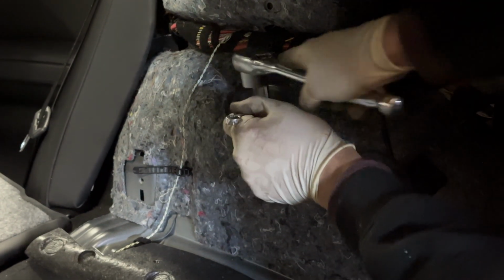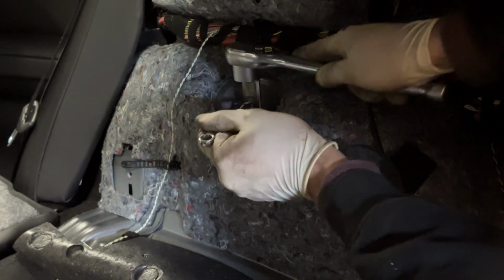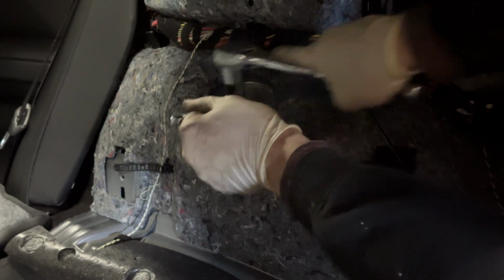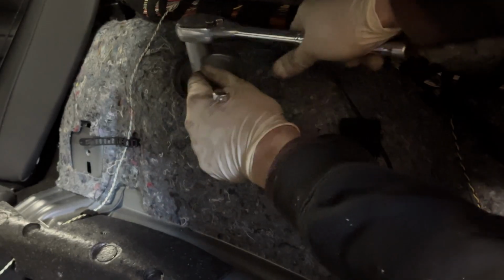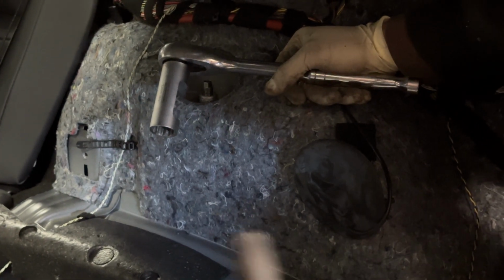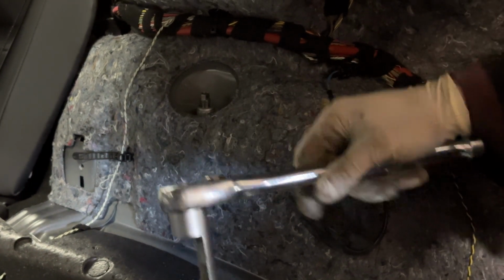It's pretty tedious, but the only way to do it, right? Yeah. Some people will just gun it off. If you're unlucky and you try to spin it like that, you'll spin the actual strut itself inside of the housing of the shock, and you can wear out the seal prematurely.